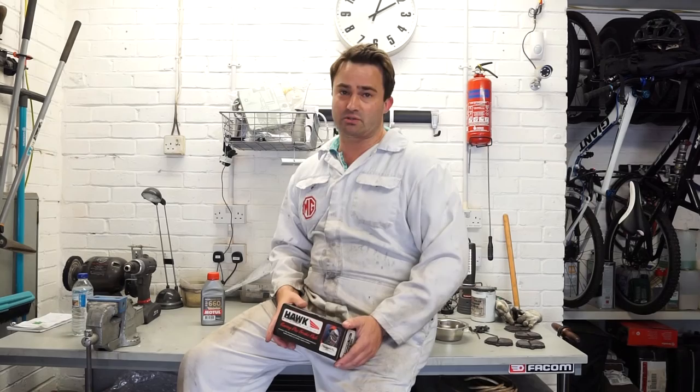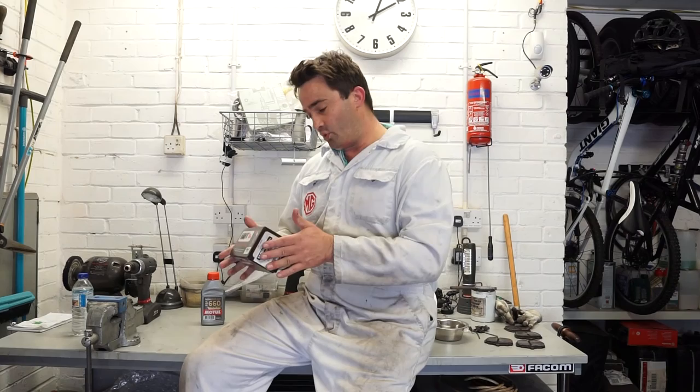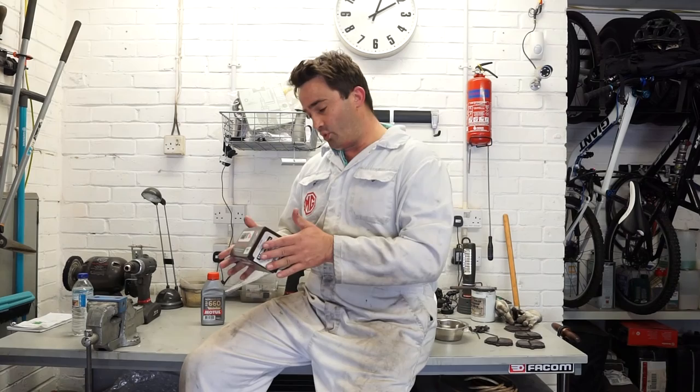With the brake fluid level checked, you're now ready to begin the running-in procedure for the brakes. The instructions are fairly similar between manufacturers — often going to around 30 miles an hour then coming to a stop several times with the brakes hard on. It gives you instructions on the back of the box and it's well worth looking at these to make sure you do it correctly. Also do remember the first time you use the brakes they won't be very effective, so keep that in mind. I hope this video proves useful — please feel free to add any comments below, and like and subscribe to the channel if you like what you see. Many thanks, bye.